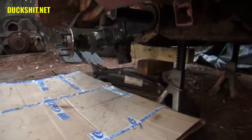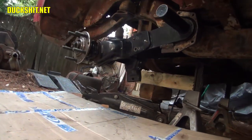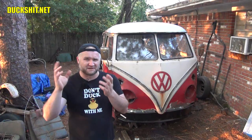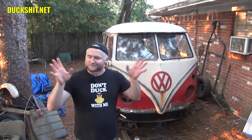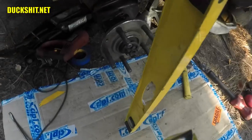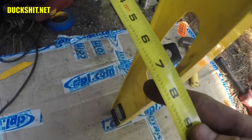Things are just not going to look right. And my second problem — this is the big one — is I plan to add a Porsche brake set to the back, and that's going to push them out even further. So roughly they're going to be shoved out something like two inches — inch and a half, inch and three quarter, approximately that. So what I did was I narrowed the rear end about an inch and a half, and I measured to the inside of the hub against the outside of the bus. When I did that math, it turns out that I was like one and five eighths inches further inward.